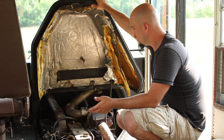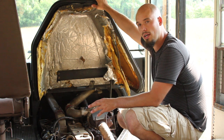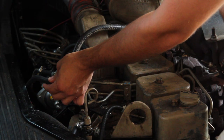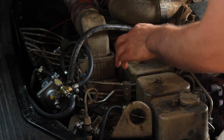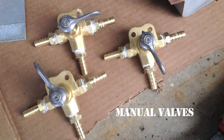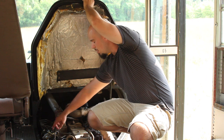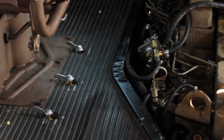Now we come into the engine bay and this is the Cummins 5.9 diesel engine — the same engine found in Dodge trucks. We don't have to make a lot of modifications in the engine bay, and there are no modifications to the engine itself; we're just modifying the fuel system. Up here there's a brass tee: one side comes up from the veggie filter and heat exchanger we just saw, and the other side comes from the diesel tank. Both tee in there and then go into the injection pump. The diesel line comes up to the diesel filter and through to the diesel hose, while the vegetable oil line comes from underneath where the vegetable oil filter and flat plate heat exchanger are.